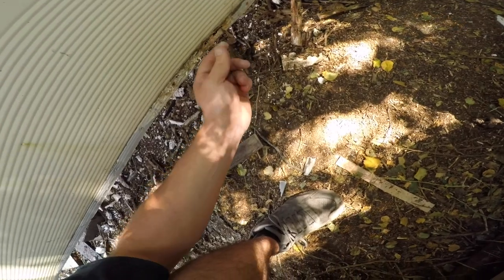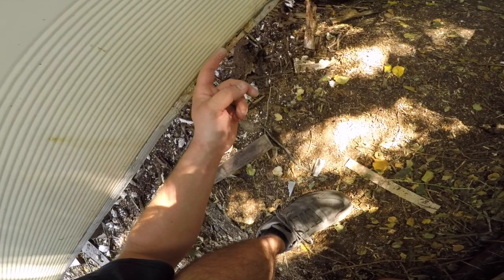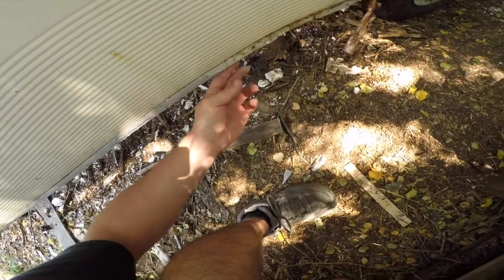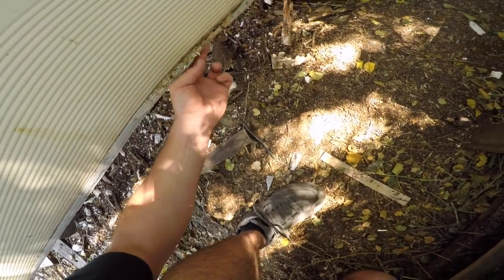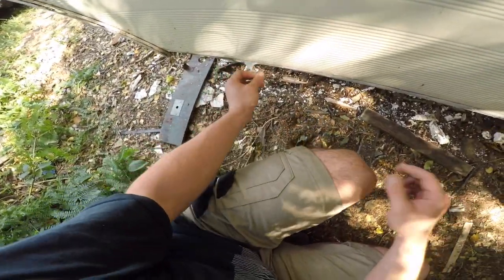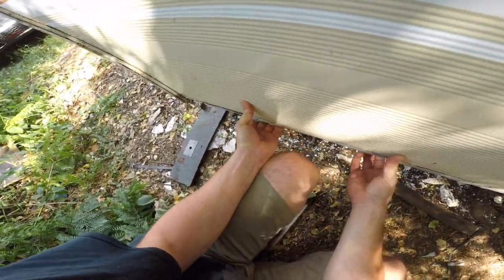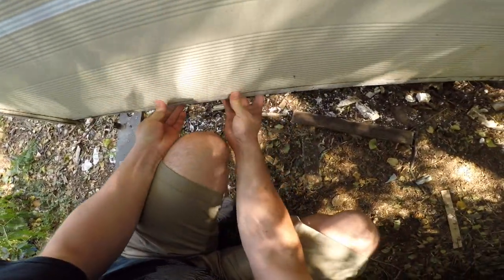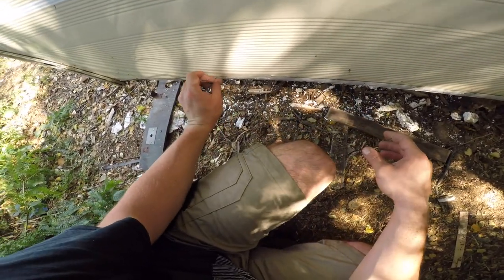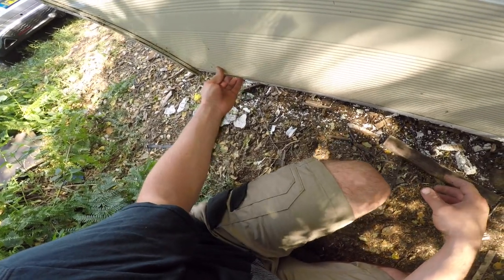You see all this stuff here — that's wrecked. And then this used to be connected to a U-shape channel here. I don't know why they did this, but if I'm going to keep this U-shape I'm gonna drill holes so water goes out. The wood that was here was soaking wet, because the U-shape channel kept the humidity and water in.